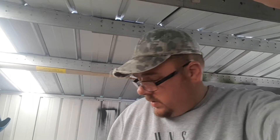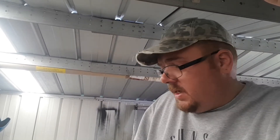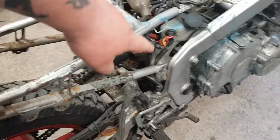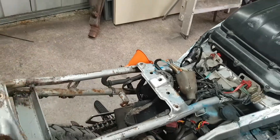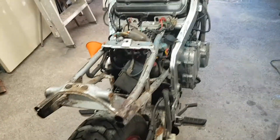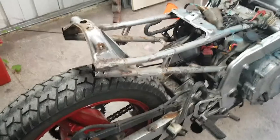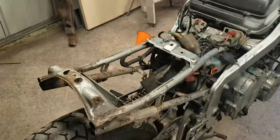Good day people, so today we're back on the CBR 600 the Hurricane. Just gonna do some cardboard templates before I start cutting metal out for the back end. The plan is to do some cardboard cutouts along here, the other side, and across the bottom, then cut that out of metal, tack weld it on. I'll do the back plate for around here with two holes in for the rear lights. If anybody's interested, I do have the front mudguard and the rear one for sale — they'll be going up on some of the forums and probably eBay, as I'm not gonna need one on here.